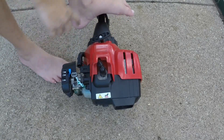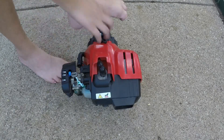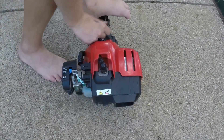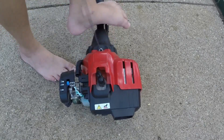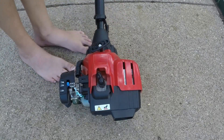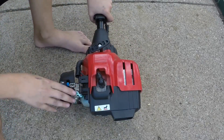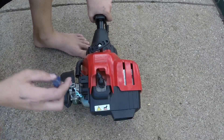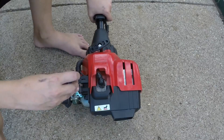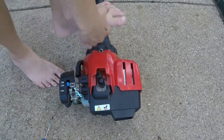Clearly we can't get the thing to start. So we pulled it five times — now we're going to move it to number two and see if that does anything. Still nothing. So here's the other step: if your thing is still not running, before you even think about changing the spark plug, try adjusting the idle. I'm just going to turn it about one fourth and see if that does anything.